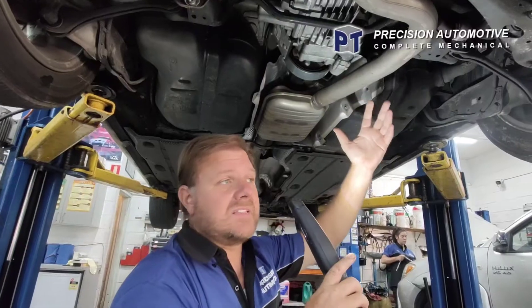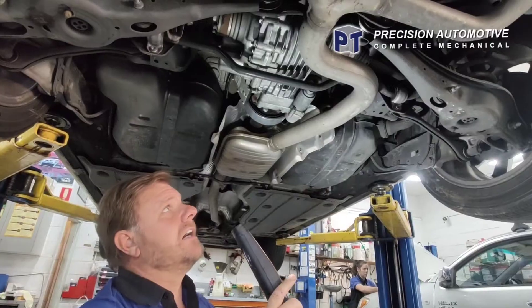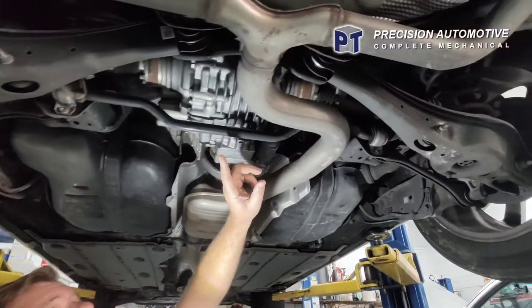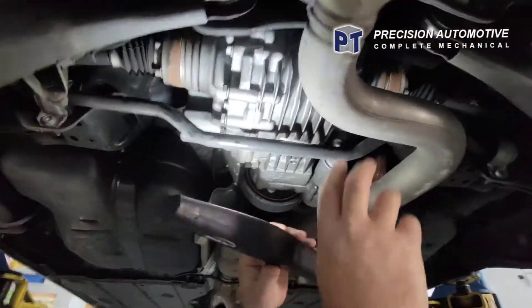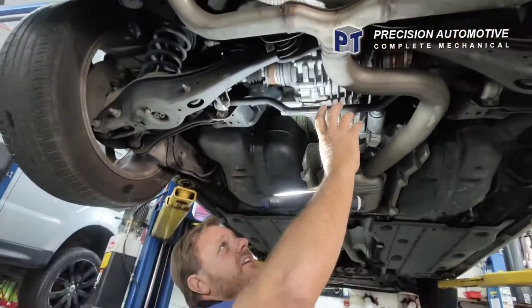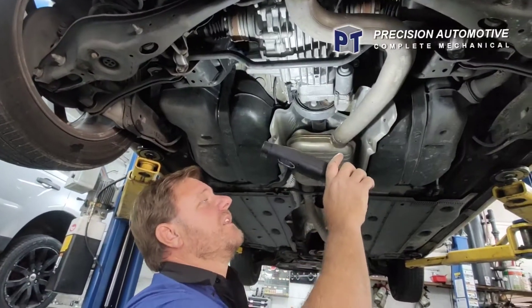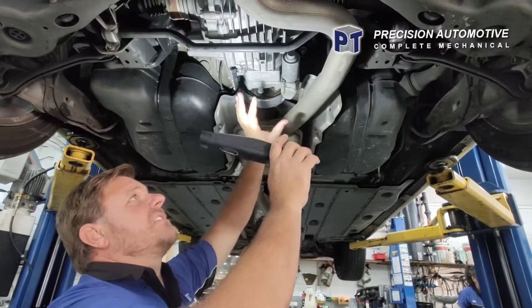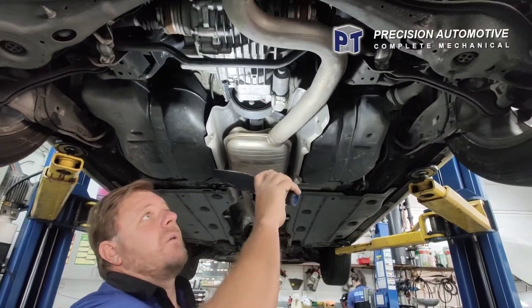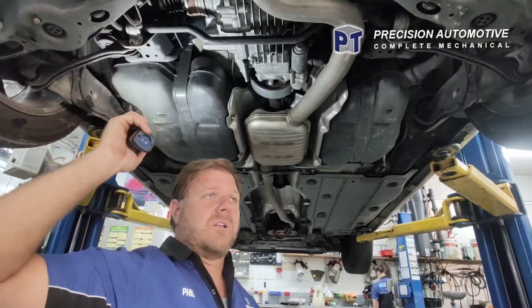See if I can rebuild this - it's only bearings, that's the only thing that's failed. It's just noisy. It's a beautiful car but very noisy on this carrier bearing. I'll do them all once I'm in there. I'm thinking you pull this casing off and that whole section - the whole differential - will come out. The Haldex unit I'm not worried about, that'll just come off the front - it's just got a clutch pack and stuff like that on it. I've never done one before and I don't know anyone who has pulled one apart.